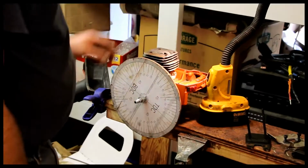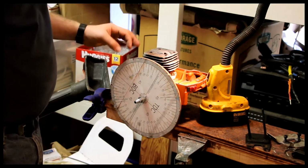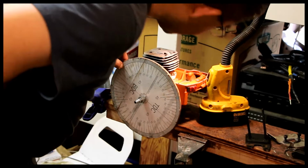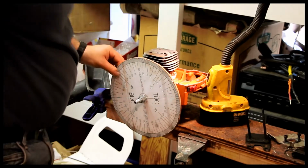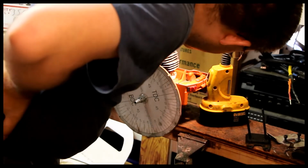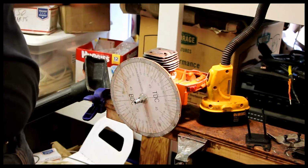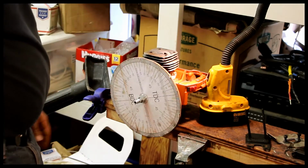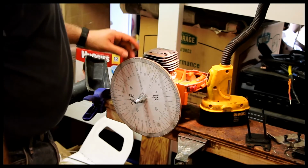start putting it together. So I've got the cylinder head on with just 2 bolts and a gasket, and the timing numbers look pretty close. Intake is about 72. Maybe didn't quite drop it far enough, but it's darn close. Pretty close to 72. The transfers are right on 118. Exhaust timing is 103. So we have hit our mark more or less there.